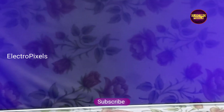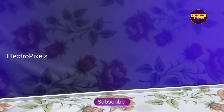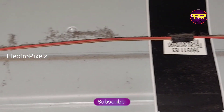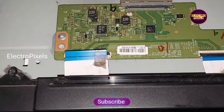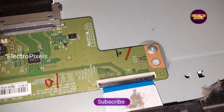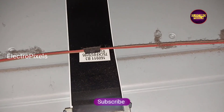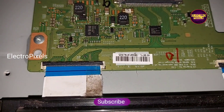The blue-shaded color is still visible because of the backlight-related fault, and the complaint remains the same. Let me check again whether the left side FFC cable is properly and fully inserted. We will reconnect the left side FFC cable.